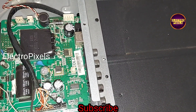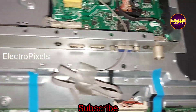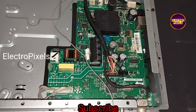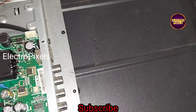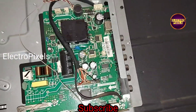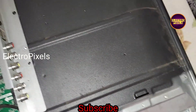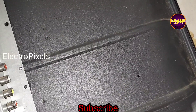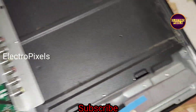After replacing the backlight, we should always try to enter into service mode. In service mode, you need to adjust the backlight level for getting a longer backlight lifetime. You need to keep the backlight level at a minimum of 30 percent to a maximum of 60 to 70 percent.